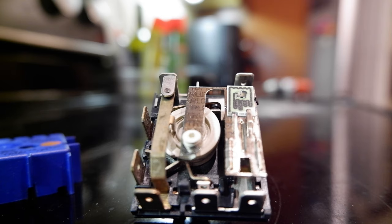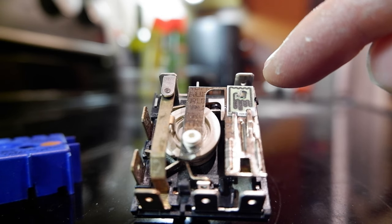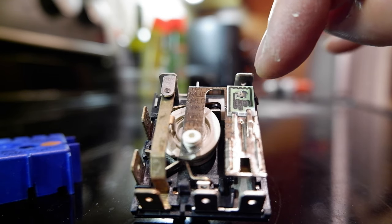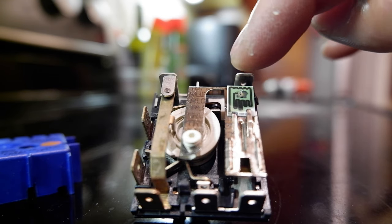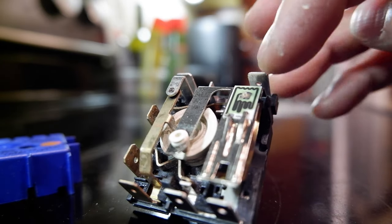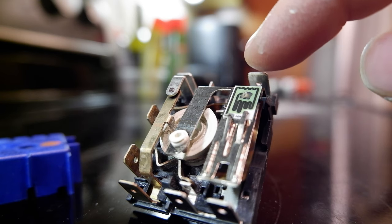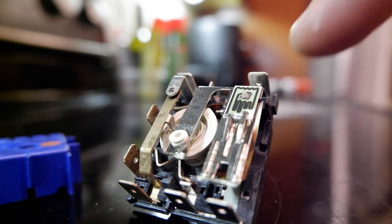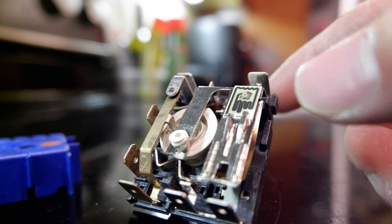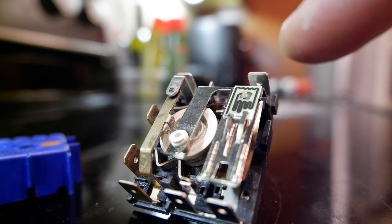So I found my issue. I took the switch apart and discovered this little chip right here, which is the potentiometer — it's got a little spot that looks like it's burnt and it's actually flaking off right now. That's what controls the temperature. Once that thing heats up to a certain point, it sends current through it and it flips up and down to make a contact activate. That one is burnt out right there — so that's what failed on this thing.